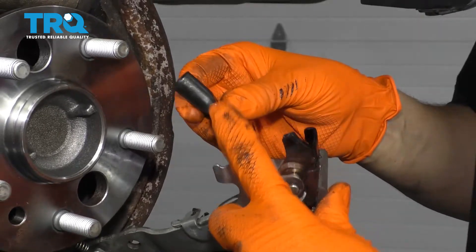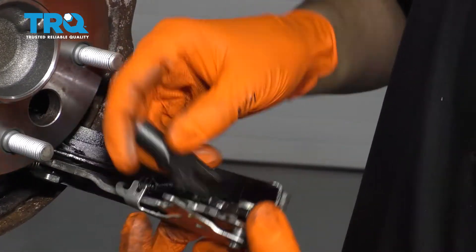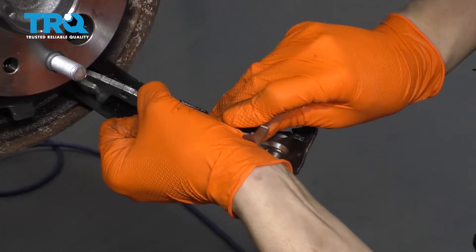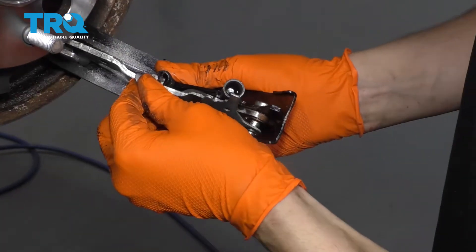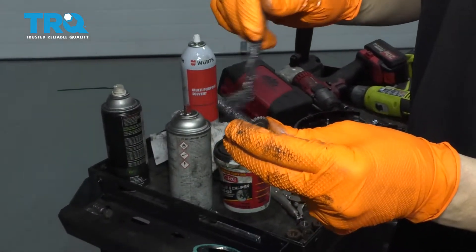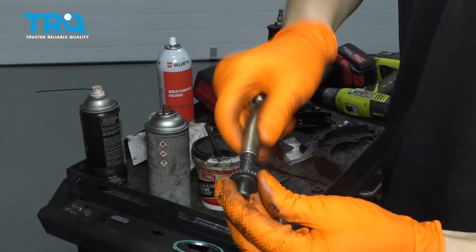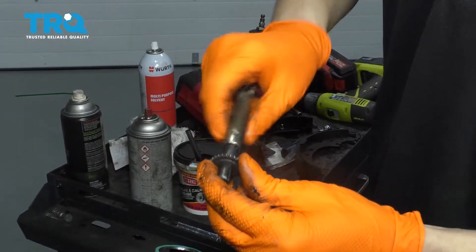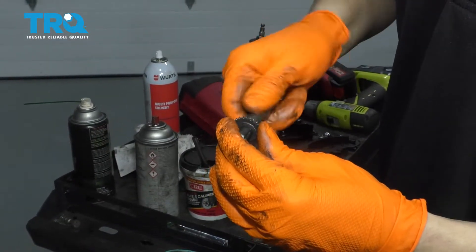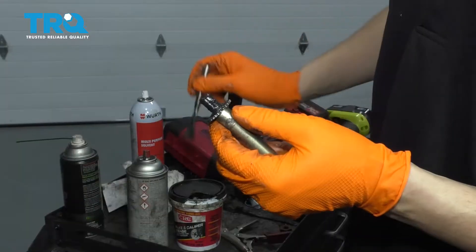I'm going to take the end of the adjuster — the one that is not threaded — and slide it into this cutout here. I need to pull on the parking brake lever as well so this pin goes through that hole. As gently as possible, slide this end in and then slide this over — that's what it has to look like. Before the other shoe goes on, make sure you grease up your adjuster. Put a little bit of grease on the threads and start the adjuster with the threads completely bottomed out. I can adjust it after the drum goes on, but if it's bottomed out I know I'm starting at zero. This end also gets a little bit of grease — make sure you still have your little washer in there.